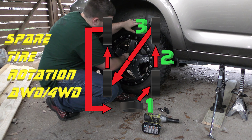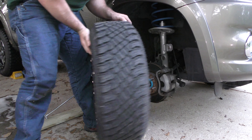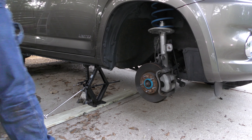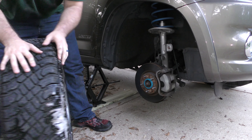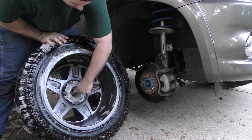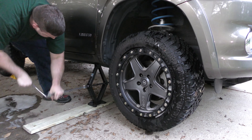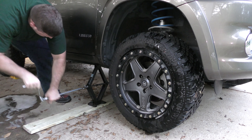I need to get back on topic. Rotating your spare is a good habit to get into. For those of us with aftermarket wheels, you'll also want to make sure that if you have hub centric rings, they're installed properly. I found it's best to leave them on the hub — you can see the blue ring here. But sometimes they will stick to the inside of the rim. And if you have one stuck on the rim and one on the hub and you try to put the wheel on, you'll need to go buy new spacers because you'll flatten both of them and make them useless.